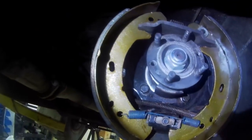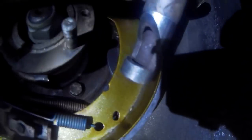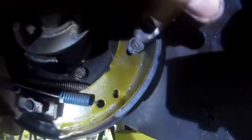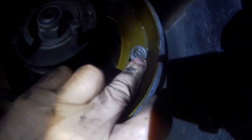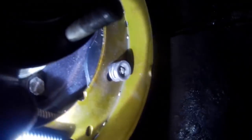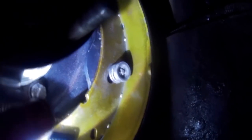Everything's lubricated up, it's time to put it back together. So by using this tool, which I showed you earlier, we were able to put the pin through the back and then twist and turn it 90 degrees to lock the spring and the returning clip all together. And if we look at the side, you can see how tight you have to compress those springs — they're very tight. There's not much room for playing around. So that in a nutshell is all the handbrake mechanism put together.